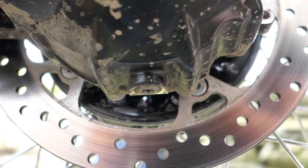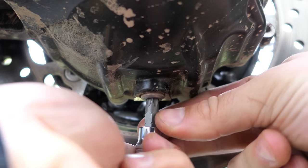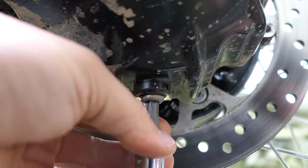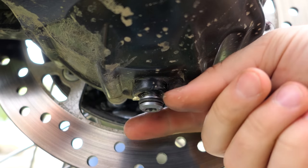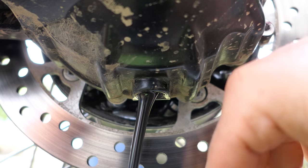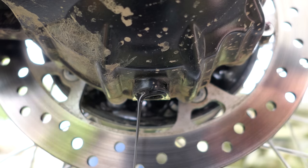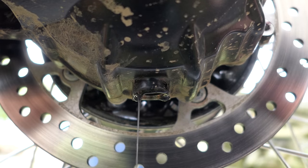Have your measuring cup ready at the bottom here — it's ready to measure that out. The bottom plug has a rubber O-ring attached. For 600 miles I'm not going to replace it, but at 6,000 miles make sure you have your O-rings — the copper washer up top and the rubber washer on the bottom. This may be hot coming out, so just be careful. Oh man, black gunk. That looks terrible. I can now see why BMW requires you to change at 600 miles.